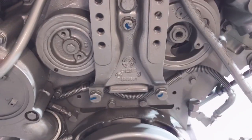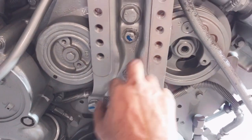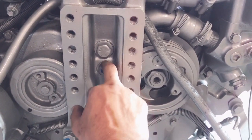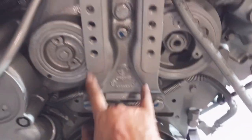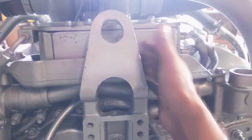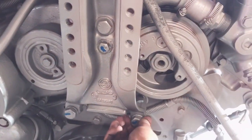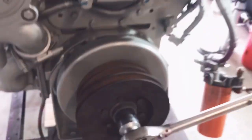Got to put the engine cradle back on. This is the engine hoist — that's going to come off. We marked these bolts blue because they have to go back in. If I leave that bolt out, I'm pretty sure I lose turbo boost air coming out of there, so that's got to go back in. This engine hoist bracket comes off because it's in the way of other stuff. Put these bolts that are marked blue back in — that'd be good to go. There's my new pulley.